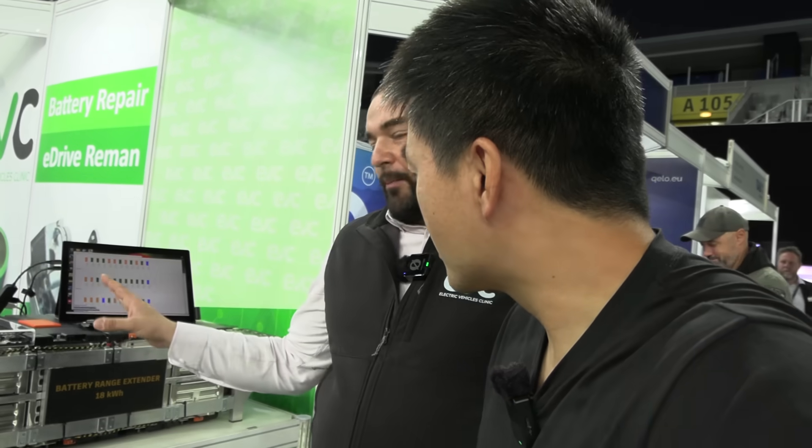That's awesome. So guys, if you're interested, maybe we should ship one of these units. This is the prototype; we are preparing the second one. Prepare a second one, ship it to Norway, and then maybe Nasir or Vallemar could put it in one of the cars — a Tesla maybe. Let's say we put it in my P100 Ninja, and then you will have a net 100 kilowatt hours. Then you should make a 1000-kilometer challenge or a range test. And a charging test, because you will get an increased charging rate — the Tesla BMS will check the internal resistance, the voltage drop is not too high, then it will allow more current to go in. So suddenly the classic Tesla could take maybe 170 kilowatt or get a full flat charge rate till 60%.